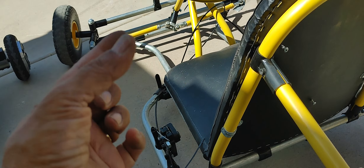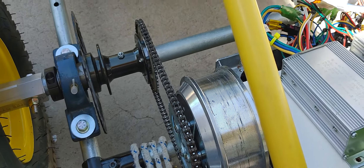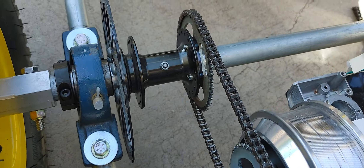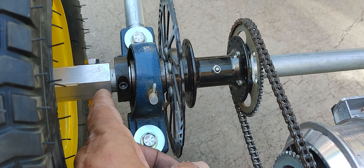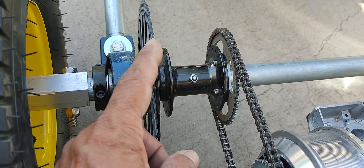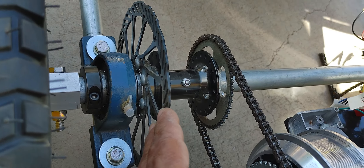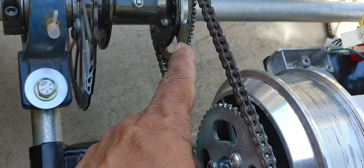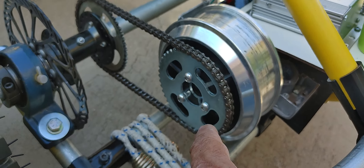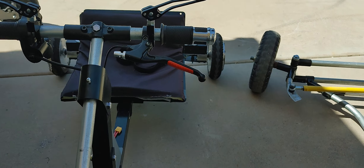I much prefer just having the bar pressed and fitted that way. I shortened this axle here — it's also EMT tubing that's been customized so it fits inside the one-inch ID ball bearings. I had to put shims there, and it's got these clamps. I'm using these bike hubs that come with disc brakes, and I was able to also install these sprockets.